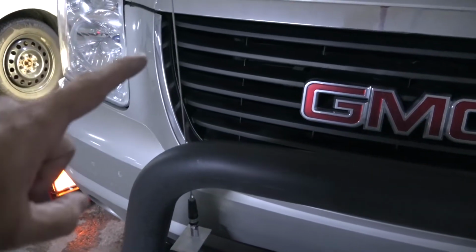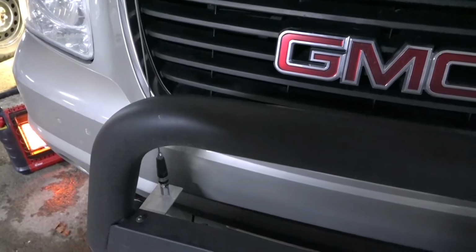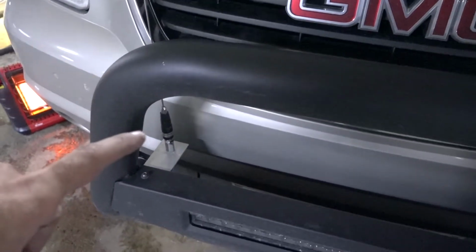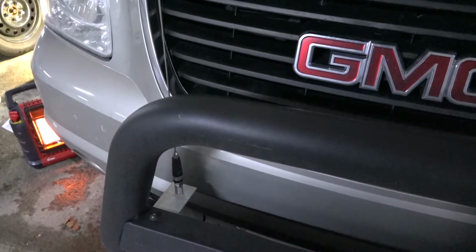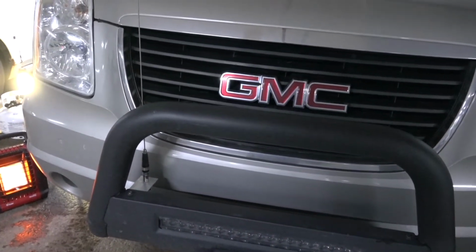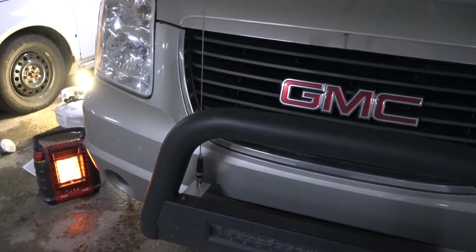Now, I am not going to be using this antenna. This antenna is only a 3-foot stainless steel whip antenna. What I am going to be using is my buddy actually gave me his Firestick fiberglass antenna. It's a 4-foot. I also bought a spring and a quick release for the antenna. That's going to be all put over here. If I want, I can take the antenna off really quickly, store the antenna inside the truck, and then just use it day to day. And when I'm ready to go wheeling, stick it on there. The spring's going to be there just in case I hit a tree or snag on some branches or something. There's going to be some play that the antenna can do, so that way it doesn't break.